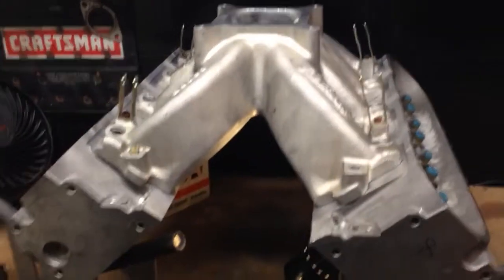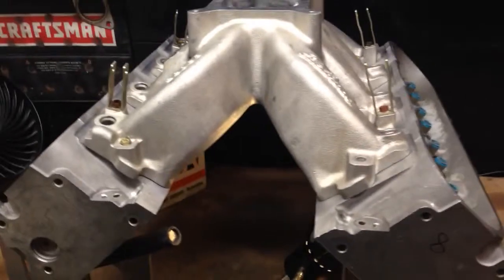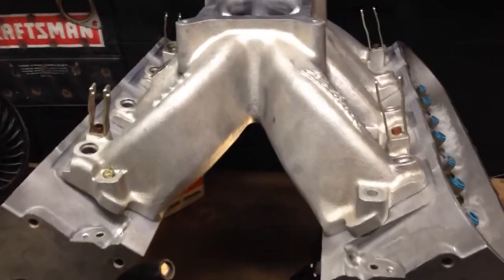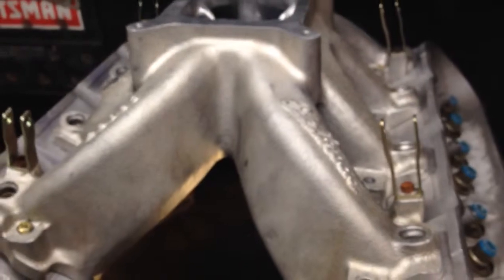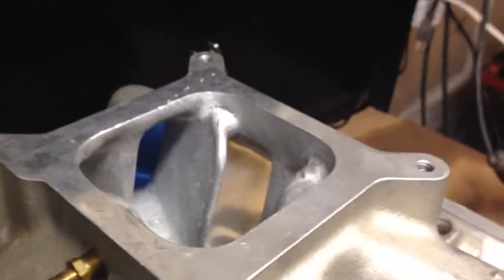Here's a quick update on 243 DIY hand ported heads and manifolds. I just have them loosely bolted up, not even using the right hardware. I do use these allen head bolts that I turn down — it helps you center the manifold. If you're bolting the engine together, you might use something like that as locators while you tighten the outer ones down, then pull the locators out to ensure proper fit.